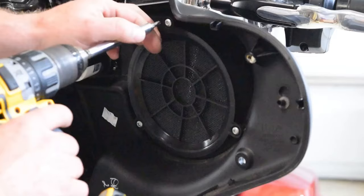I got the positive and the negative wire run through there, as you see. Here's our ground and our hot wire runs right through here underneath the gas tank. And then we're coming across the plastic channel right here. It stays up underneath the gas tank. Now this will be visible. It's going to sit in a channel up here, and then it runs down to the respective terminals on the battery here.